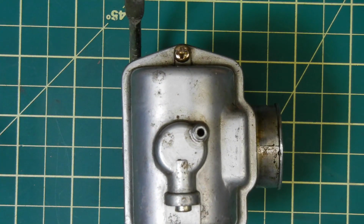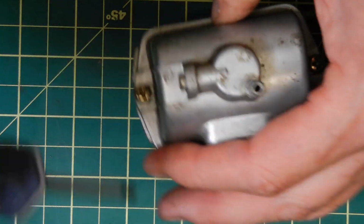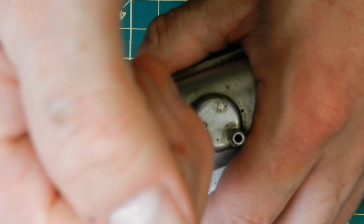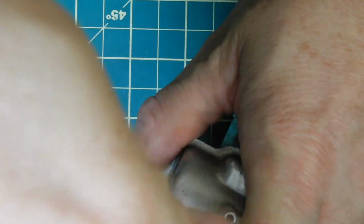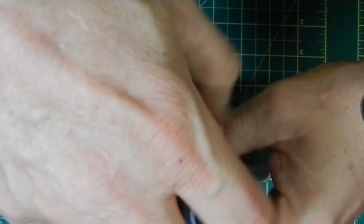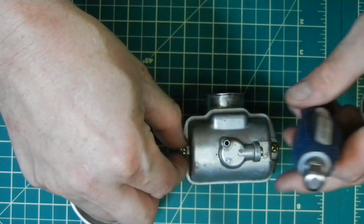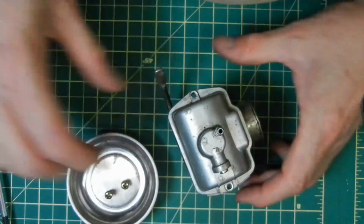To get the float bowl off, we do have to take off these two screws on the bottom, and I'm going to use a JIS screwdriver here. One of my subscribers recommended that I use these, and I have to say they are superior to a Phillips. In a pinch, you can use a good quality Phillips screwdriver, but if you do this kind of work on a routine basis, well, you know what? These are, I think, a good investment, and I certainly would endorse them.